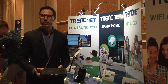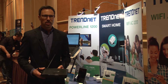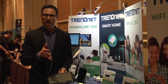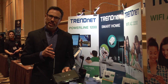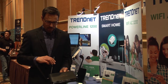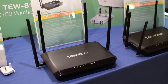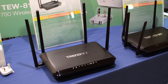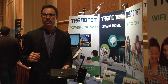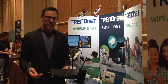Internally, the router has this new technology called MU-MIMO, or multiple user MIMO. With older routers, when multiple devices were connected, all the devices would have to wait one at a time for their information to be sent. With MU-MIMO, this router can now send all those information streams concurrently at the same time, resulting in much higher performance in real life environments where you have a busy connected home with a lot of connected devices.